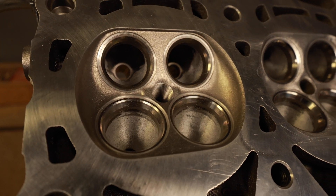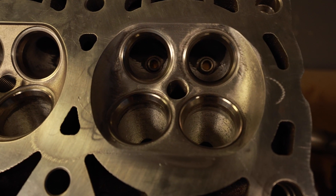Just getting rid of all these hot spots — now this is done and we can go to the CNC. I want to mention this is really more important for guys who run pump gas, because if you run E85 it doesn't detonate, although I still think having the chamber done is an advantage — just less of a worry. If you're a pump gas guy, this is the ultimate mod, because you detonate very easily and detonation takes out rings, breaks ring lands especially in the Subaru, beats bearings out, and does a lot of ugly stuff. You can get rid of all that for three to four hundred bucks, so it's a really strong supporting mod for the valve job or the pocket port.